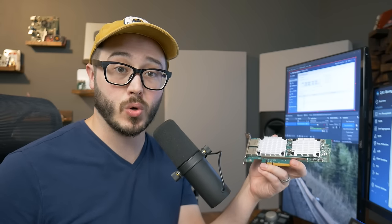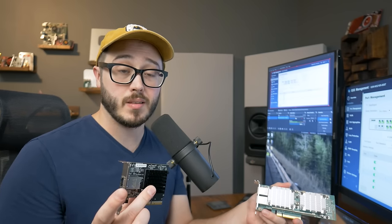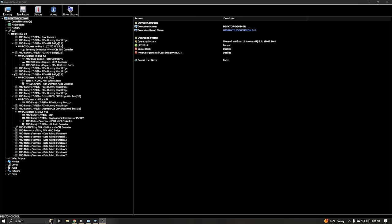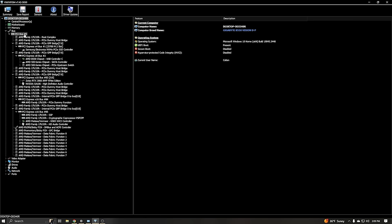Now I want to see which NICs will work in my desktop and which in the TrueNAS server. I tried plugging in the Inspur Intel X540-T2 card, but it's not showing up in my network adapters — and even in HWiNFO64 it doesn't appear anywhere on the PCIe bus. I did some looking online and it seems some people have had issues with these working in certain motherboards. Since it doesn't show up at all in hardware info, it's not a driver issue — the PCIe device just isn't being seen. I'm going to try that little IceWhale NIC instead.